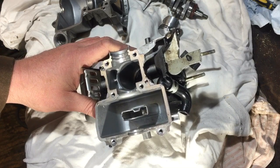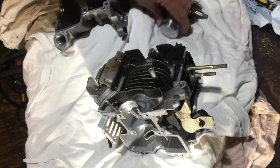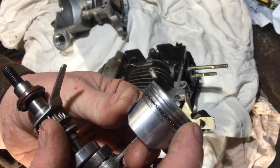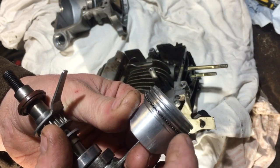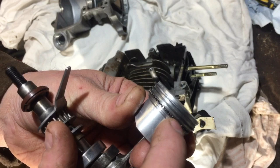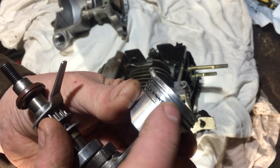It had a couple of scores on the old piston. I think the oil ring or something had worn, because on these you've got three rings. There's one with a little spring — that's like the oil ring. There's one normal type ring, another one, and then there are two very thin rings and the spring bit goes in the middle.